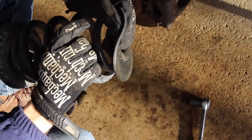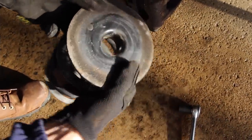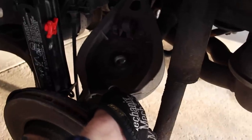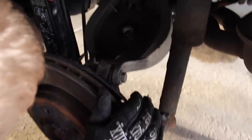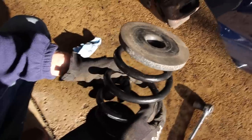The top mount is on top, the bottom mount is on the bottom — the bottom one is a lot thinner. They're pretty well stuck in the spring. Unless you need to reuse them, just leave it all in there and throw the whole thing away. If you are going to reuse them, pry them out, clean them up, and seat them in the new spring in the appropriate location. Now is a great time to clean out the trailing arm with shop towels and maybe some degreaser — clean around the nipple and the top seat as well.